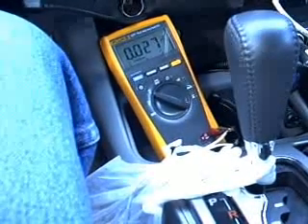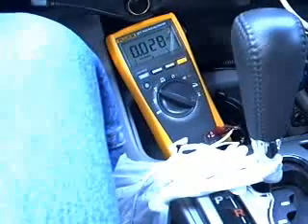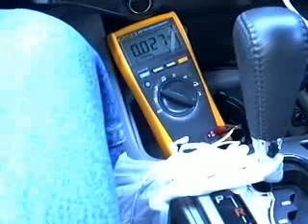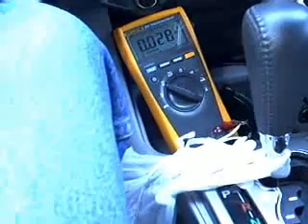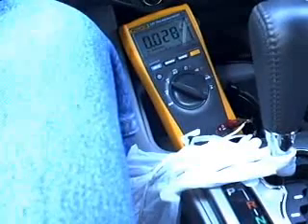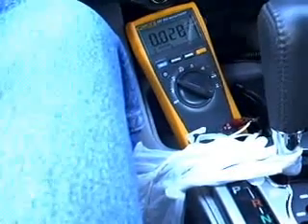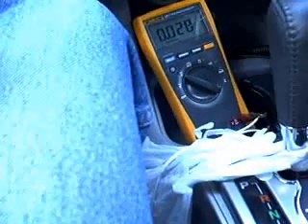Typically in the morning when I start the vehicle, it starts out at around 14 amps, just a little over one liter per minute. By the time I'm finished driving at the end of the day, the cell has warmed up to the point where I am drawing anywhere between 35 and 38 amps — where I want it to be — producing three and a half liters per minute.